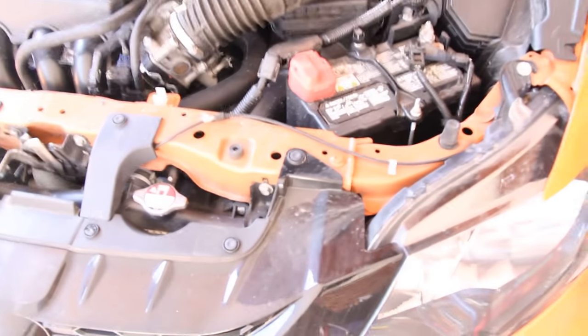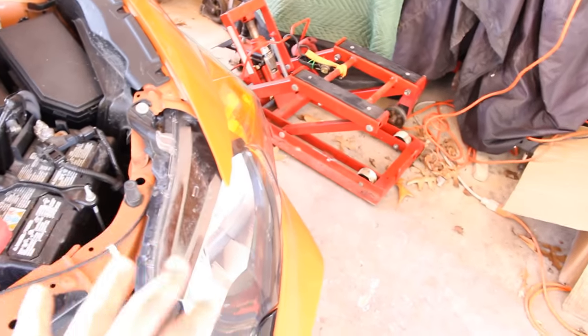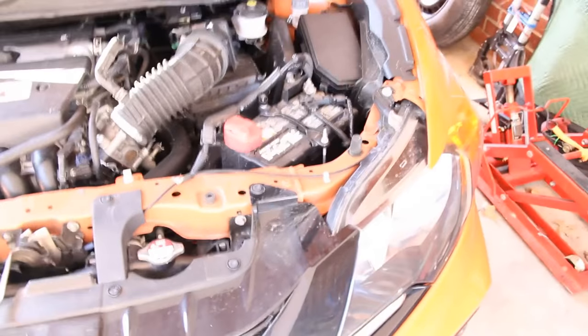It looks like we're actually going to have to take off the headlight assembly itself in order to make this install as simple and easy as possible. That means I'm going to have to remove the front bumper in order to get to the screws on the headlight assembly. It's an unfortunate thing — I wish it was a little simpler. But with this crowded engine bay, this is possibly the only way. So let's take off the front bumper.